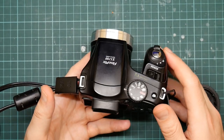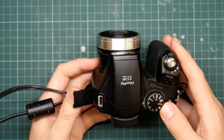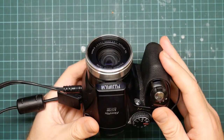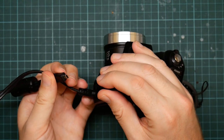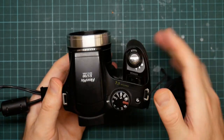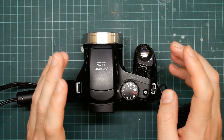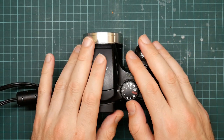I mean, it's not a brilliant camera. It's years old and wasn't particularly expensive, even when new. But I think this will do fine. What I'm going to do is not try to use the camera's own controls to actually film the spider. I'm going to try and drive it from a PC using the USB connection, which is a non-standard thing that the AV is coming out of. It can either be analog, composite video, or USB. At least, so I hope. Anyway, I believe that I now have a working infrared camera, which is nice. The next step is to light the spider's enclosure somehow, and for that I will need an infrared floodlight. So I am going to tackle that one next time.